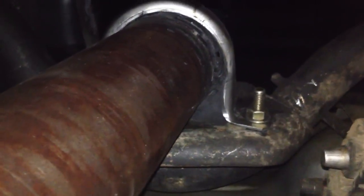Definitely going to need a new carrier bearing — it's gone. And I'm thinking, because of all of the pits here along the drive shaft, I'm going to need one of those balance parts. The balance parts are still here, but I can see there's no tack welds.